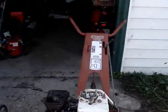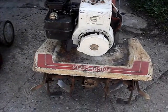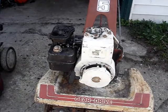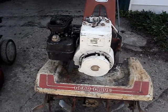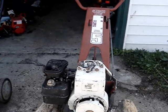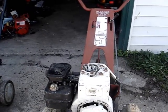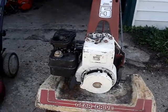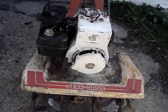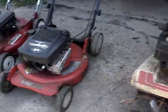First is the 1976 Garden King rototiller. If you remember the video I made of it, I got it at a rummage sale. I had to replace the carburetor and gas tank because they were really grungy. It still needs a little bit of work — it needs a new coil because the coil wire's all torn up, even though I taped it.